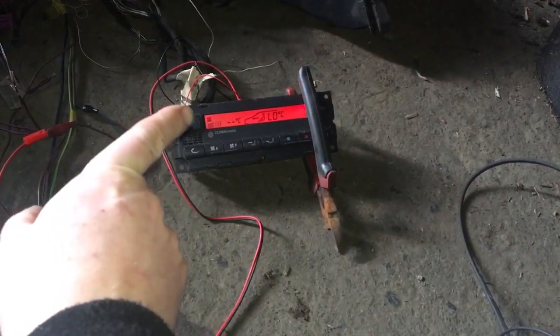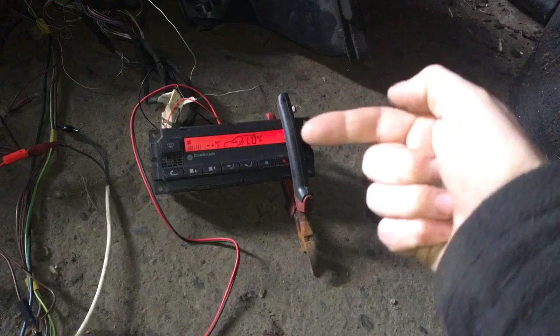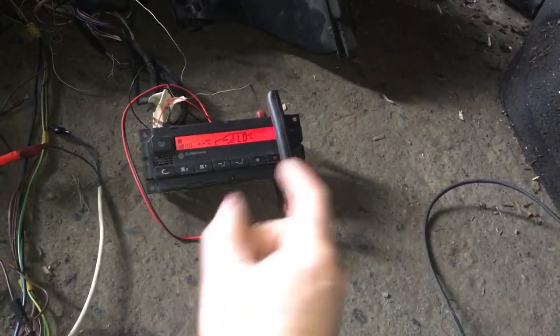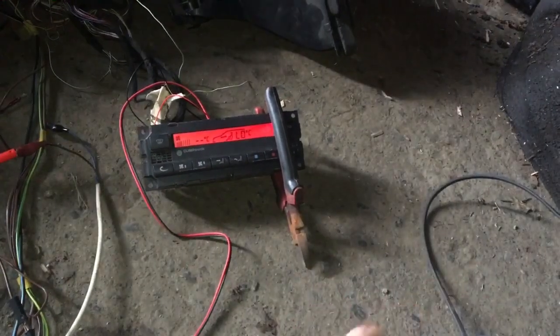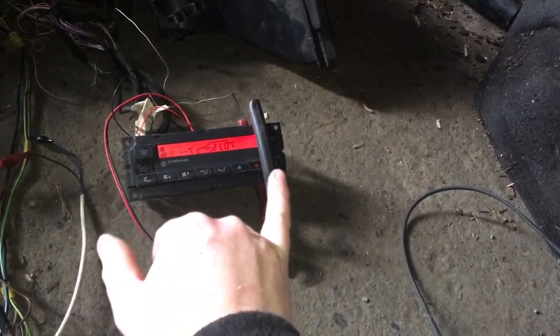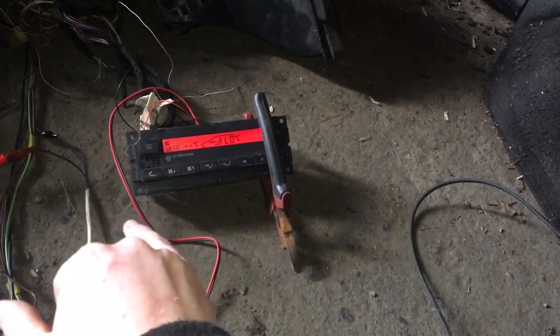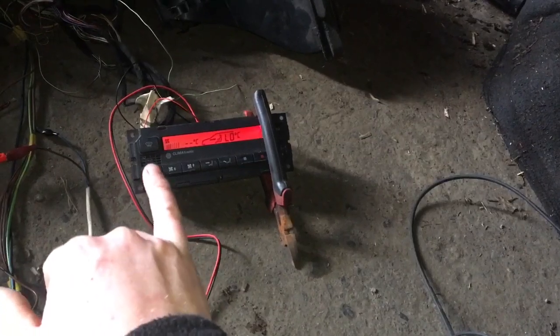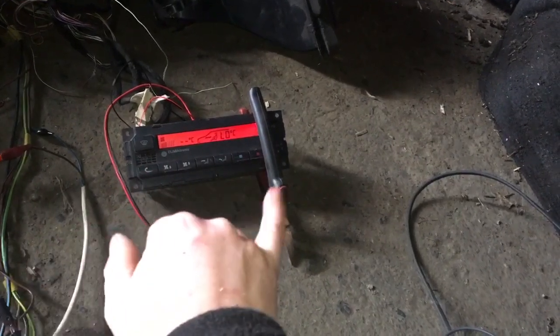Currently I have an LED pointed at each side to illuminate the screen — that's how the screen is on, but the buttons are not lit. So I've bypassed the original LEDs by putting in my own. I've ordered green 3mm bulb LEDs that are going to fit in the buttons here. Behind each button they're all hollow so they should all fit.